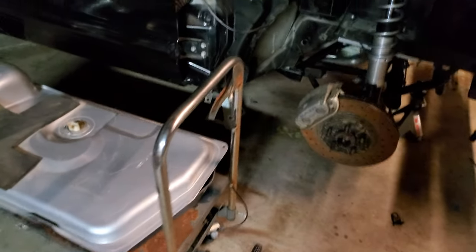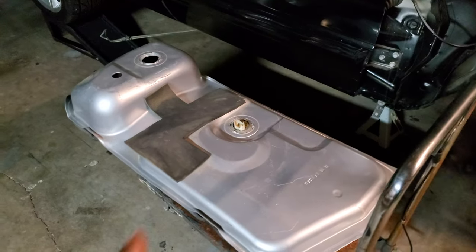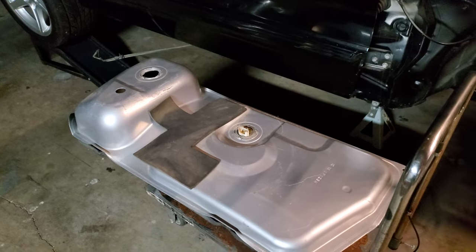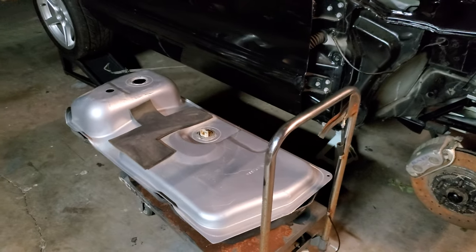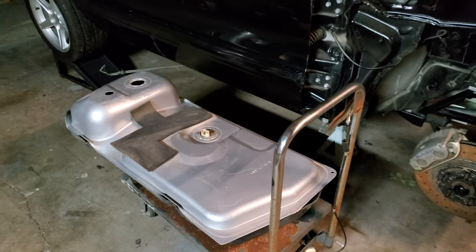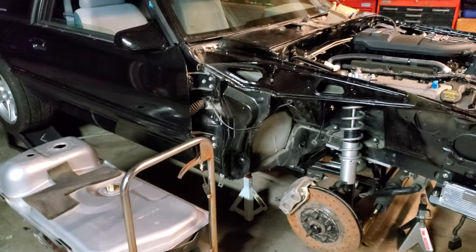I have a four-eye fox - mine's a '79 and an '85, both four-eyes. If you're using this style of fuel tank you can't use the fuel level sensor that works for the carburetor style. I believe the only one that works is for an '86, which is tough to get. If you happen to have an '86 fuel-injected Mustang, that fuel level sensor is almost gold - you can't find it to still use the four-eye gauge cluster.